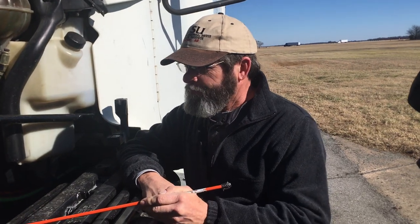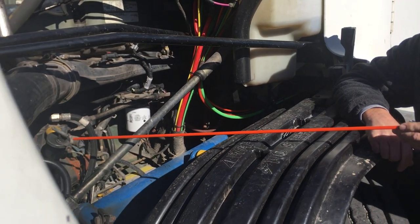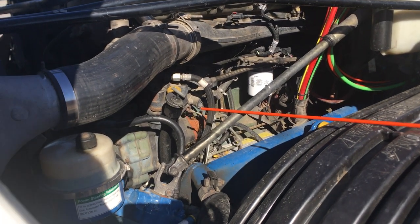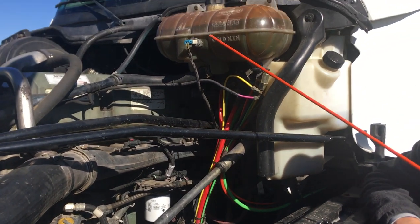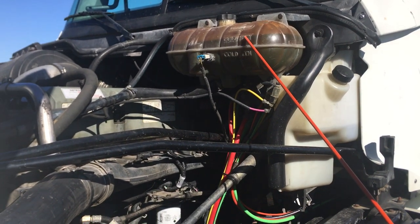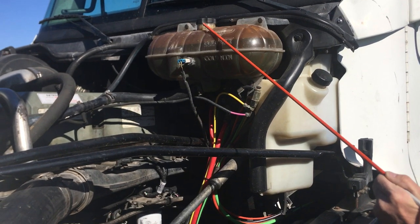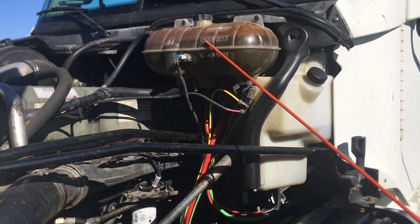Now we're on the left side, the driver's side. Oil dipstick is right here. You don't have to pull it out, but if it was on the add mark, I would add one gallon of oil in the filler tube. They're both securely mounted, not broke or cracked. Next, I want to go to my coolant reservoir — it's one of those jugs you can see through. It's almost on the max cold line, not below the min line. That sensor there — if it gets uncovered, the truck's going to die. If I needed to add fluid, I would add it right here in the filler cap. It's not leaking, securely mounted, not broke or cracked.